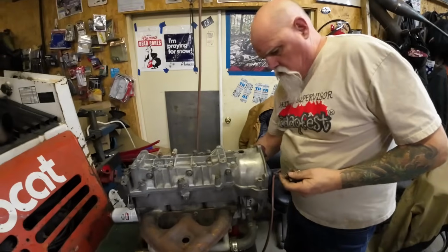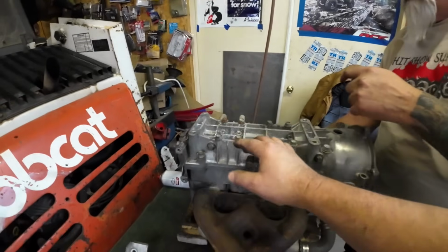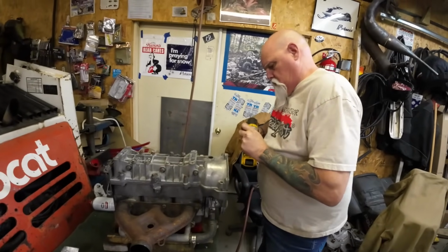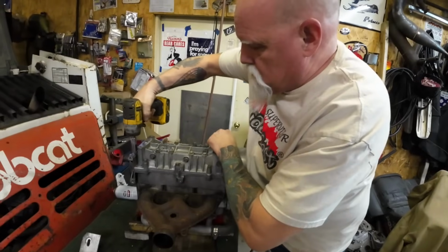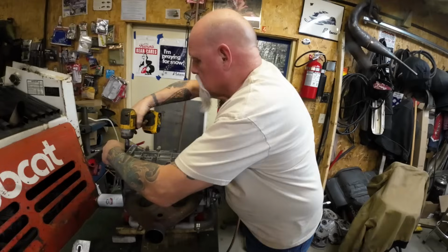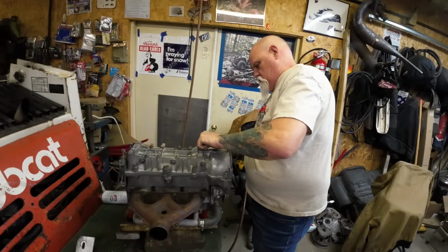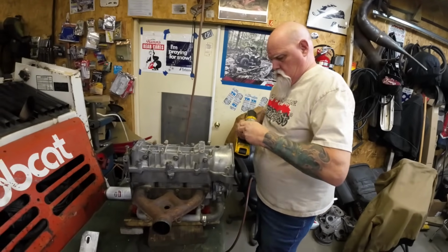All right, now Lonnie's going to switch over to the 14, and we're going to work from the outside in, doing opposite corners. So we'll do this one, and then this one, and then this one, and then this one, or whatever. He can pick wherever he wants to start, but we're going to do the opposite corners. We got 4 big 14s, and then we'll switch back to the 12 millimeter socket. Okay. Here. Yep. Perfect. Yeah, that's life. All right, back to the 12.